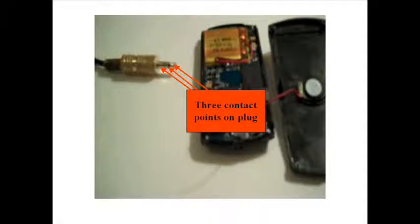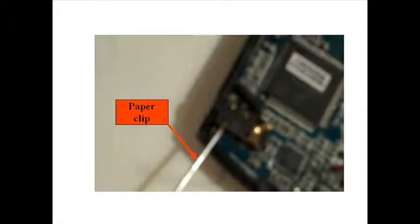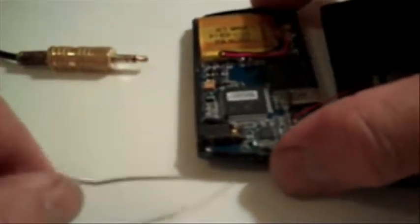The first thing you want to do is get a paper clip, bend it straight, and put it against one of the clips that are housed by the receptacle. Then what you want to do is push in so as to create greater spring tension — now this contact will make a better contact with the jack plug. There will be a second contact point as well, and you'll want to push that in also in order to increase its tension.